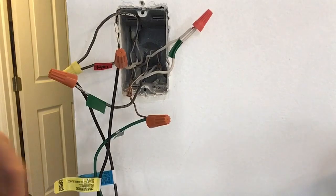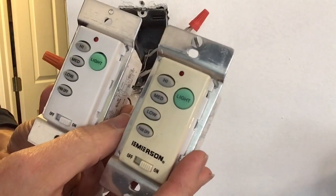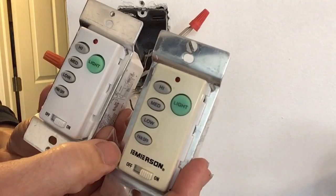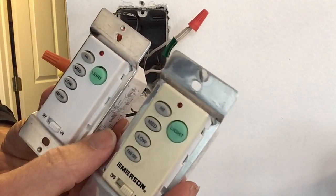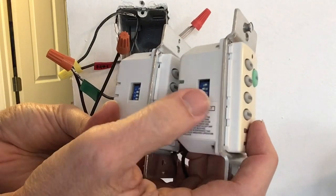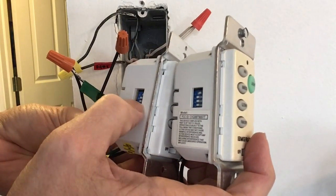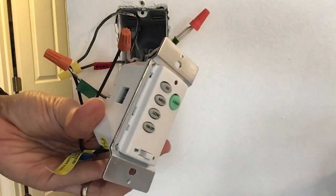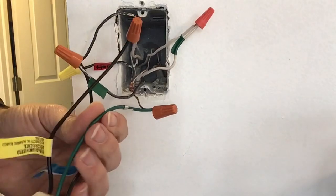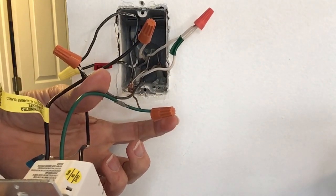If you are installing this sort of remote, I was able to buy replacement remotes on Amazon. The replacement looks pretty much identical to the original Emerson except the plastic had started to discolor. To make the remote work properly you have to make the DIP switches match across all units. This one has the first switch in the up position and the other three down. When you get them they'll all start in the up position, so you just use a screwdriver to push them up or down.